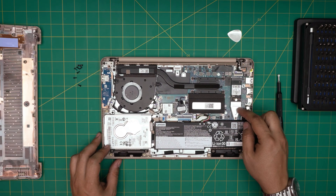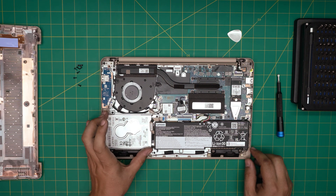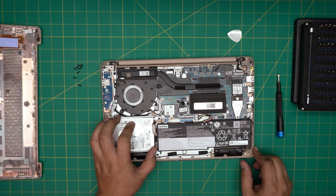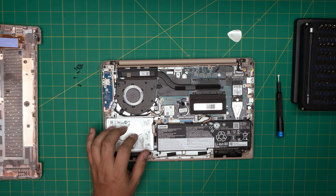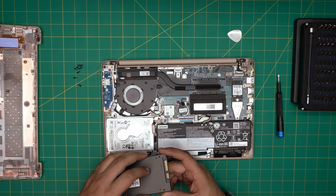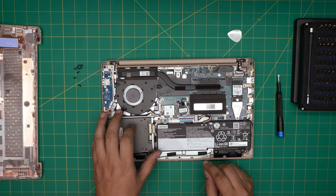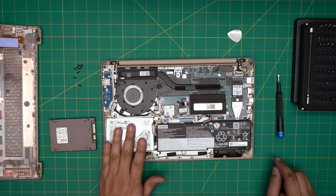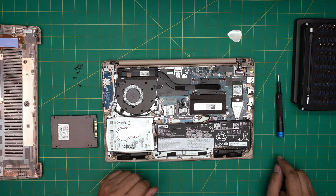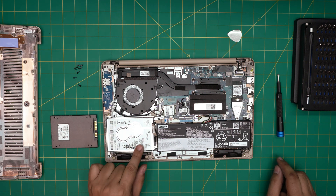Right away you can see the SSD storage over here and the mechanical drive right here — about a one terabyte low-profile hard drive. You can replace this mechanical drive with up to a four terabyte solid state drive, because all solid state drives are low profile and will fit right in here. You can go up to two terabyte mechanical drives, because after two terabytes they become really thick and will not fit.